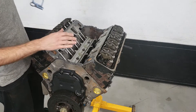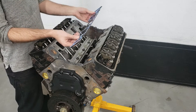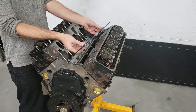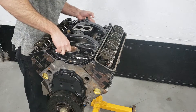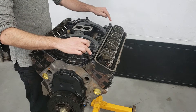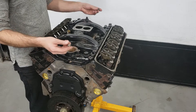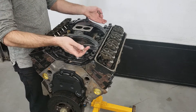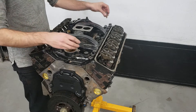I've left the silicone to dry for about five to ten minutes so it starts to cure, and now I'm ready to put the gaskets and the intake on as well. On this particular small block Chevy, because of the heads, the outer corners are blind holes so they don't need any thread sealant or silicone to stop oil from backing out. Only the center bolts are going to need any kind of thread sealant.